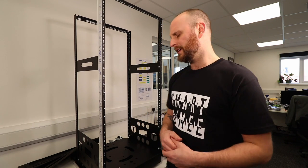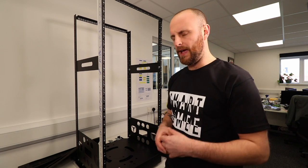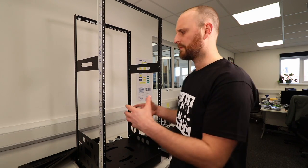This can be done in two ways: passive and active. A passive system is a rack similar to this one, which will be an open rack built into a controlled environment in a rack room, where the air around the equipment is at a reasonable temperature for cool air and hot air to be pulled through these pieces of equipment without damaging them. That, if I'm honest, happens once in a blue moon. We try and aggressively say to clients that they need to have rack rooms, and they often give them to us, but they're not five-meter by four-meter rack rooms with a lot of space for air to cool and be managed in a way that allows for passive thermal management.